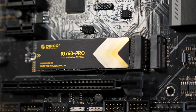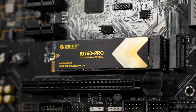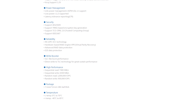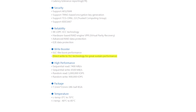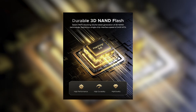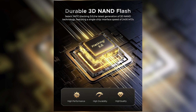That controller is pretty much in line with the other NVMe 2.0 controllers, claiming 7.4 gigabytes per second on reads and 6.5 gigabytes per second on writes, although it doesn't even have the option to have a DRAM cache even if you wanted to. They claim SLC-like burst performance — that's the 6.5 gigabytes per second figure — and also direct-to-TLC writes for great sustained performance. We're going to test that. As for the NAND flash, that's YMTC's X-Tacking 3.0 3D NAND Flash from 2022, so nothing here is super new. But to be fair, people like Lexar with their NM790 drive have this same setup, so it isn't exactly unique. Let's take a look at the performance.